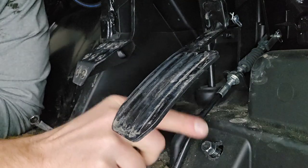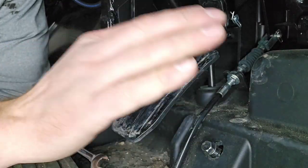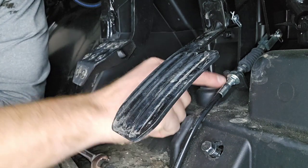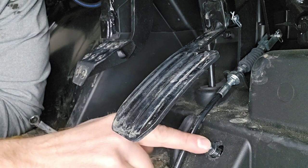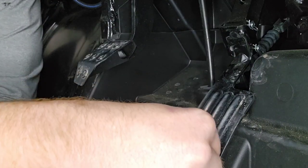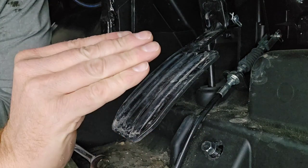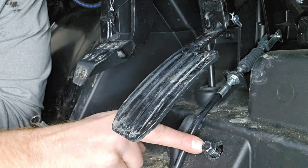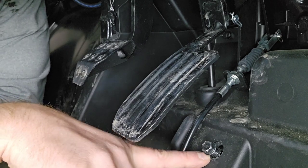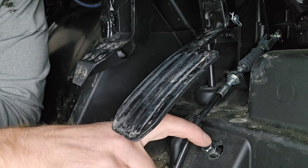Now this other screw is really just a stop for the back side of the pedal — it controls the travel distance. The further this pedal can go down, the more travel the line can go, and that has implications in the back. On mine I set this as low as possible. This stop is what determines the total throttle travel you can get out of this thing. Keep this all the way down — there's typically a locking nut down here that you'll need to unscrew first.